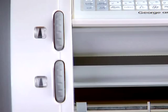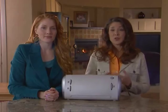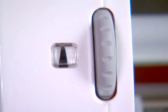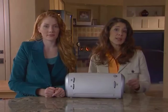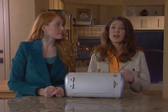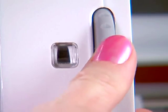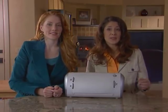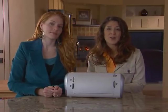The pressure dial is the third adjustment you can make to the Cricut machine to customize its cutting abilities. The pressure dial allows you to control how hard the cutting mechanism presses against the paper. For lighter papers, turn the dial down or counter clockwise to decrease the cutting pressure. For heavier papers, move the dial up or clockwise to increase the cutting pressure. The pressure dial, in addition to the blade depth and the speed dial adjustments, will prevent lightweight papers from tearing and ensure that thick papers are cut all the way through.